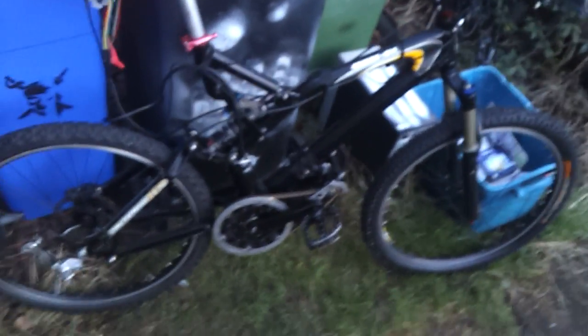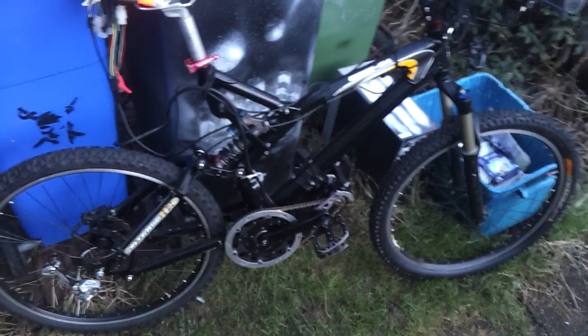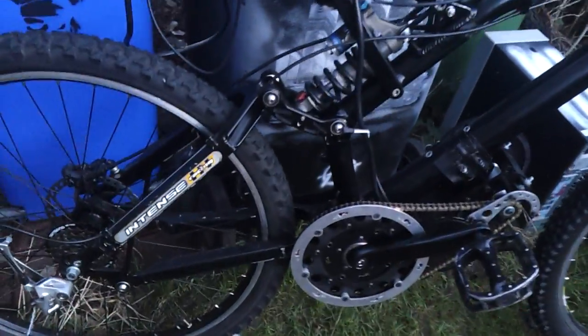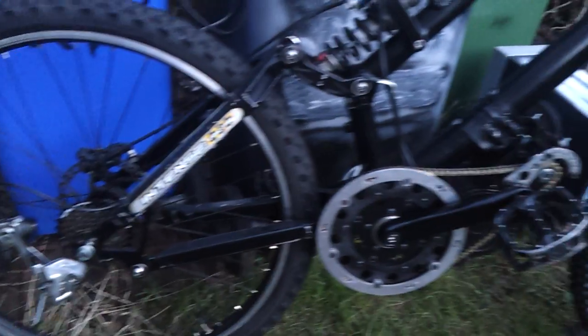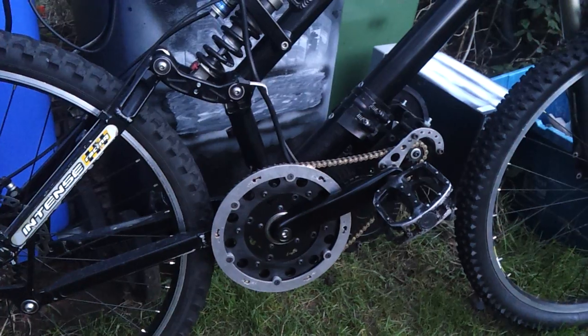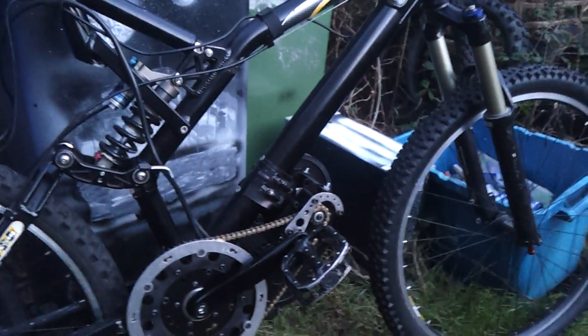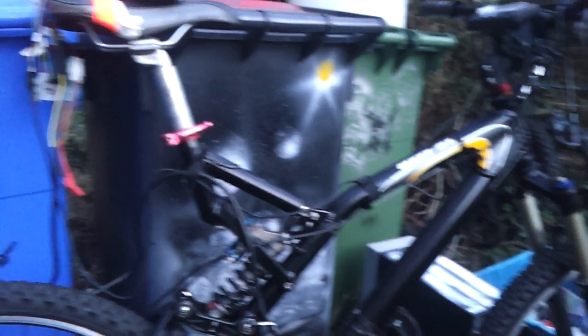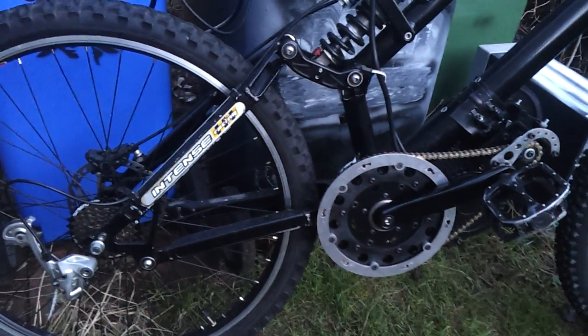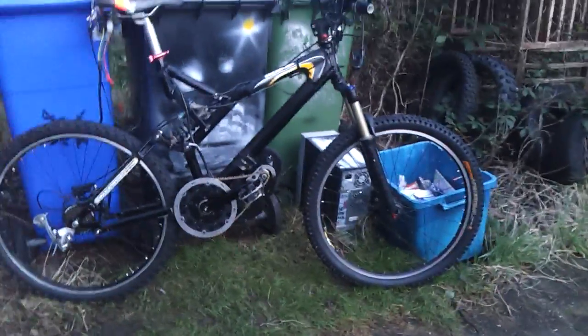For distance and for off-road, that's your best setup. If you're looking for low maintenance city cruising, hub motors are a good idea — they'll cost you a lot less in parts and the build is a lot simpler. There's a lot of people going to agree and disagree, and have their own ideas about hub motors and mid-drive systems like this one. It's all objective and subjective really, because it depends what you're going to do with it.